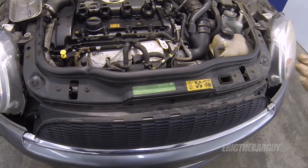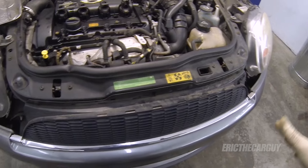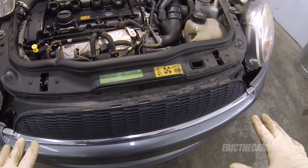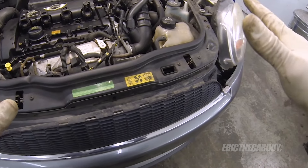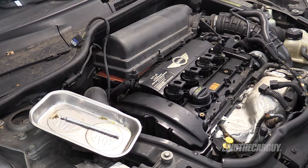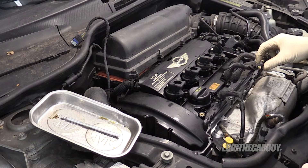I will say that I am not a Mini expert, however I have taken many things apart in my day and I'm sure we'll be able to muddle through. Let's get started. I'm going to work outwards in — start removing the headlights, the front grill piece, and all that stuff, just taking things off until I've got the front exposed. I'm going to leave the air conditioning charged up, not discharge it, and just take the condenser and AC compressor and lay those out of the way.